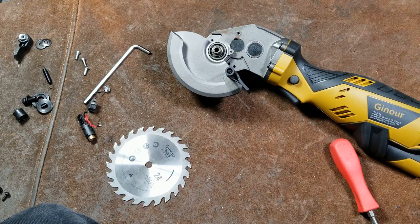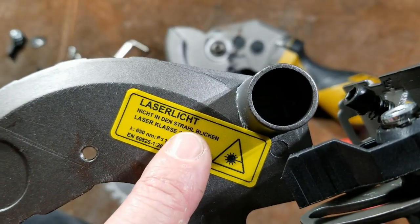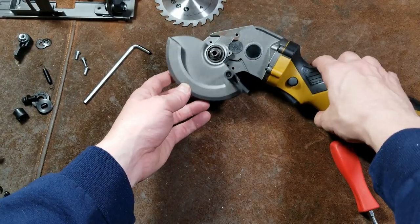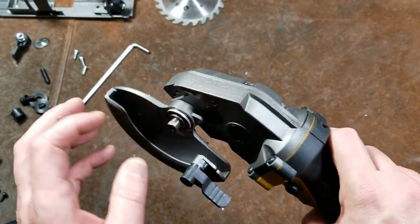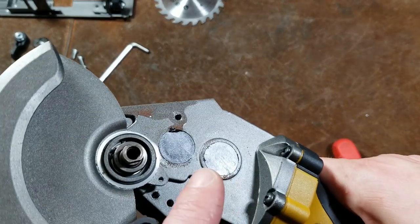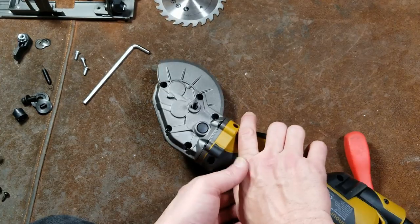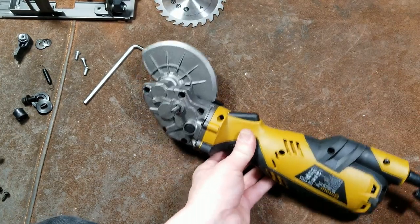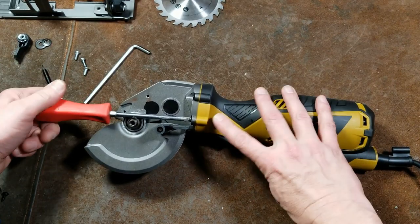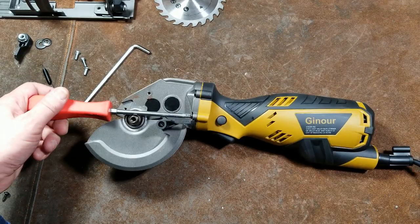There's an interesting label — 'Laser Licht' — I think that was supposed to be a 'G' instead of a 'C.' This tool is all ball bearing. In this gearbox they've just drilled through holes for those bearings and put in plastic caps, and we can see the oil is leaking out of those caps due to a poor fit. My goodness, this company really should have done a better job. I'm going to make sure these screws are tight — and this bottom screw here is actually just spinning in the housing. It's stripped out from the factory.